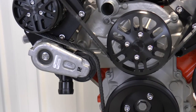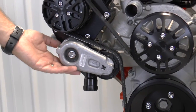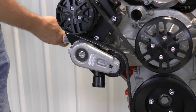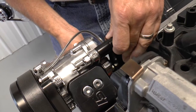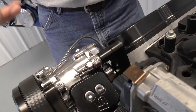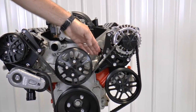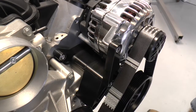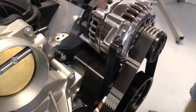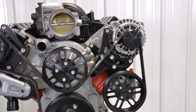A lot of the things that we brought from the supercharged kits — it has a diesel heavy-duty tensioner, so it has a lot more strength to it. We have a stronger bracket on the AC compressor to keep that thing from flexing under high-torque situations. We've added a bracket here that goes from the alternator down to the water pump. It adds some stability and some strength there. It also has an extra bolt hole into the power steering bracket that can go into the block.